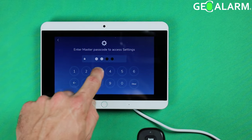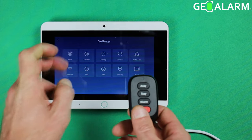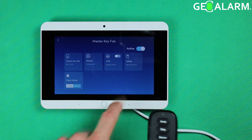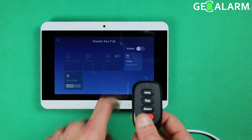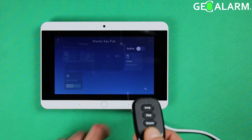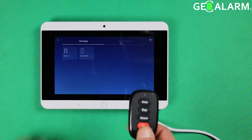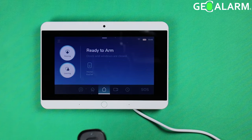That is how you enroll it. Let's go up into the menu again and then we'll delete it. Jump back in there like we did before — go to Devices and choose your key fob. You can toggle it on and off here if you plan on putting it back in at some point. I'm just going to go ahead and delete it — click Delete and then Delete again. That should remove the key fob from the system. As you can see, there's nothing left here. Hit the back arrow all the way back out to exit programming.